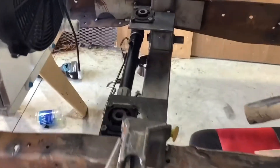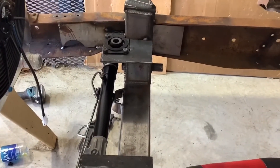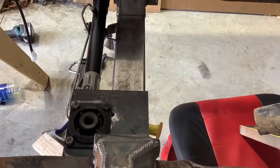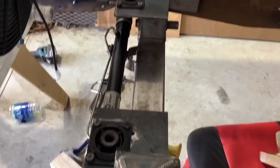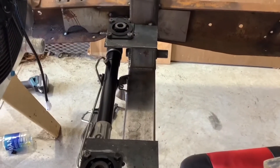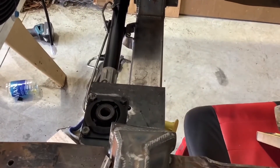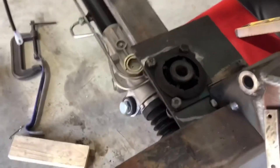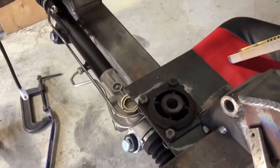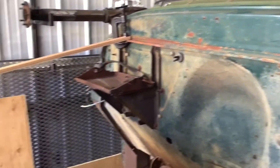I didn't video much of this because this took me all day and I just have it tacked — I don't have all the bracing in yet. These are the front motor mounts. I have had no end of trouble with this, trying to do this Mustang II IFS with this Cummins. There are so many problems. Here's my rack and pinion and I have clearance issues everywhere. I'm going to be just scraping the top here with the hood — the valve cover will fit under the hood but it's not going to have a lot of clearance.